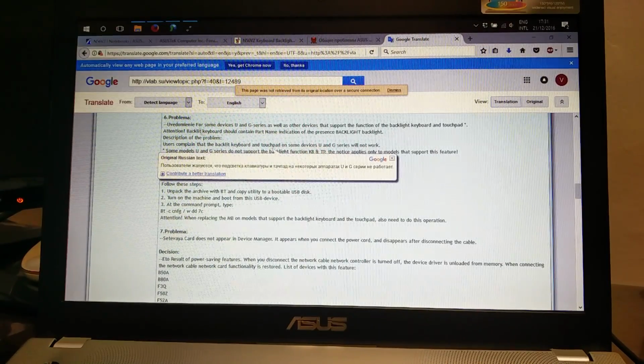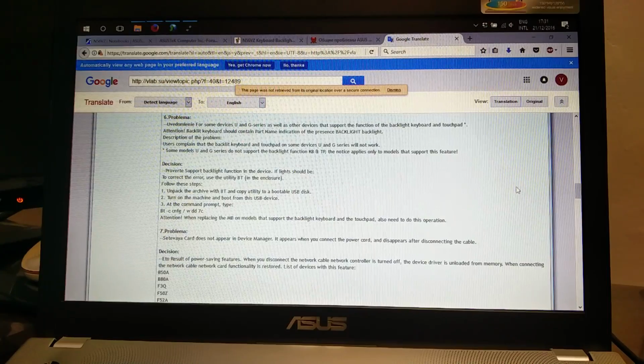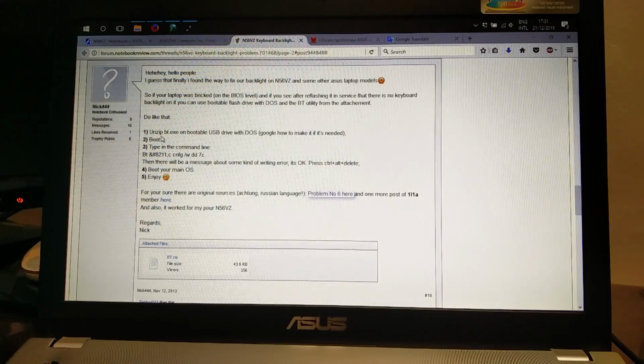What this fix does, as we can see here, is it will fix the backlight if the backlight somehow doesn't turn on. To fix this, looking back at the first forum, we have to unzip this utility, bt.exe. I'm going to put the link in the description. This utility is going to be used to change the EEPROM flag value. So we have to download this bt.exe first, and we are going to put it on a bootable USB drive with FreeDOS. I'm going to show you how to make it.